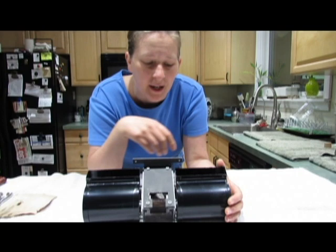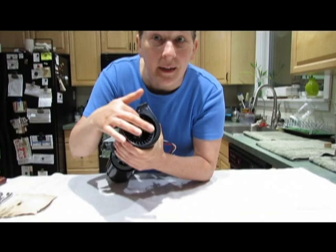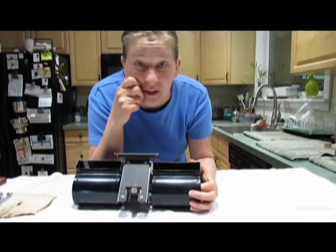I've put shims underneath and stuff, and finally somebody said to me, "Hey, did you ever clean your convection blower?" And I said, "Well, I was able to get at these, but upon taking it apart, I realized the last 8 years I have not been cleaning the inside because there's a squirrel cage that's here, and there's two sides to clean." Would have been nice if somebody showed me that, so then I wouldn't have to deal with this vibration and lots of swearing at my pellet stove.